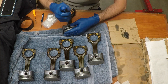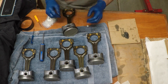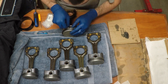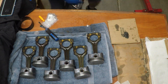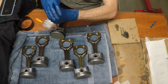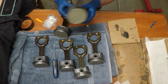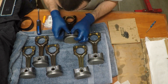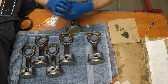The wrist pin retainers should be oriented mostly facing down — from straight down, 45 degrees to the left or right, so a 90-degree field pointing downward is roughly where you want the retainer gap facing. To install: start one tip inside the groove and push in with your finger, with the other side of the gap towards the bottom of the piston still sticking out. Then use a flathead screwdriver on the shoulder at the bottom of the piston to pry the retainer up into its hole. Push with your thumb to get it in, then a light tap with a flathead screwdriver will seat it into the groove.